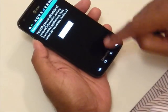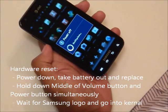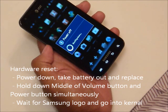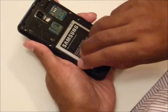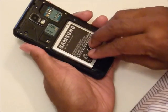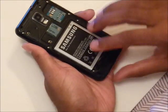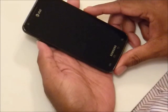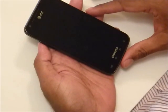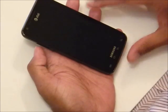So first of all what we do is go back home and power down the phone. Okay, it's powered down now, so let's flip it over. I've taken the back cover off and I'm also going to take out the battery and replace it — this is probably to clear any cache held in memory. Now, I've followed some other methods I found on Google when trying to reset, but they didn't work for me, and I needed to experiment before I found the solution for this particular phone.